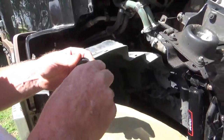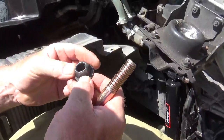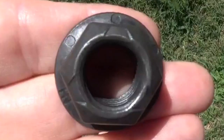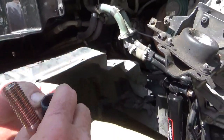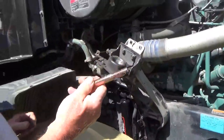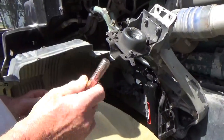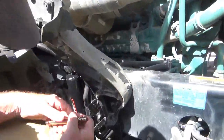And actually, these flange bolts, I don't know if you can see it or not, but that little stamp right there, and right there. What that does is bend the opening of the bolt in just a little bit. So you don't need Loctite or anything. Because when the bolt runs in, it grabs a hold of that. Grade 8. What's that mean? It means it's a super heavy duty hardened steel alloy type bolt. That withstands quite a bit of a beating.